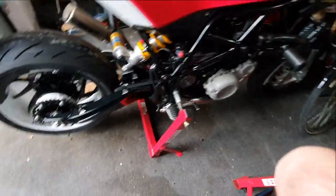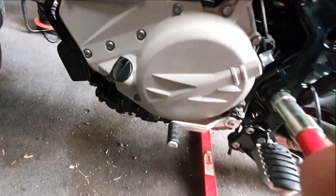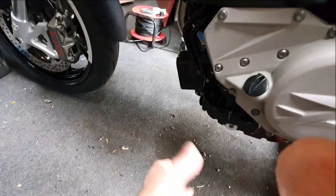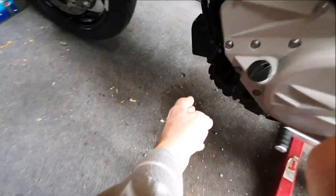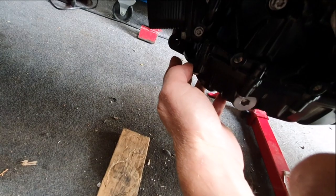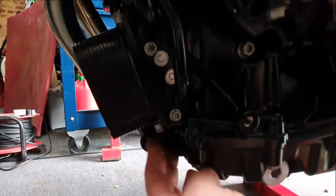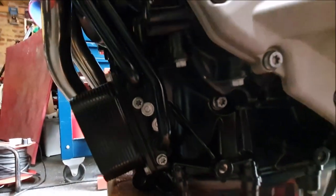So that's the Nuda again up on its back wheel. Now one last thing - about the ABBA cross section here for lifting the front wheel, we can do that but I just use a little jack underneath. This is for the Nuda obviously - I don't know about other bikes - put a bit of wood underneath there, and you'll see a couple of what looks like engine mounting points. Put that on then put a scissor jack on.